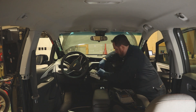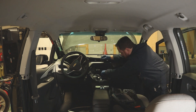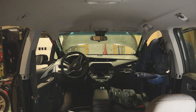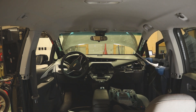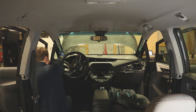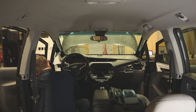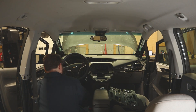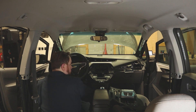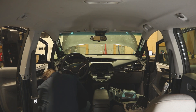The interior is held together with lots of plastic clips and screws that require a 7mm socket. On the driver's side, I'm now removing some of the trim pieces and the interior fuse panel cover. There is a small panel here that controls the headlights, and it came out easily. I will definitely try to use this in the DeLorean. The way they currently work to control the lights in the DeLorean are with a single big push button that you press multiple times to cycle through off, low, and high beams, and it's very easy to accidentally leave the lights on.